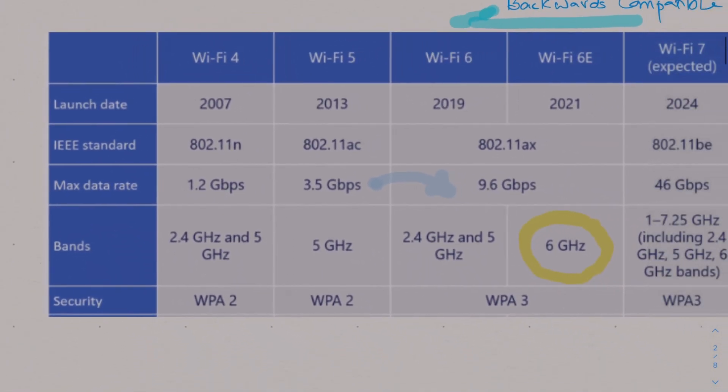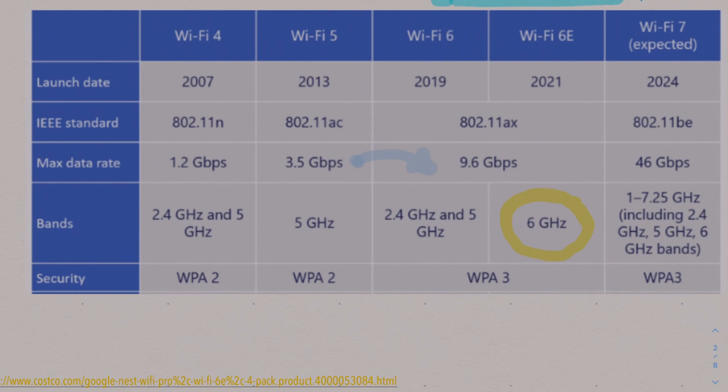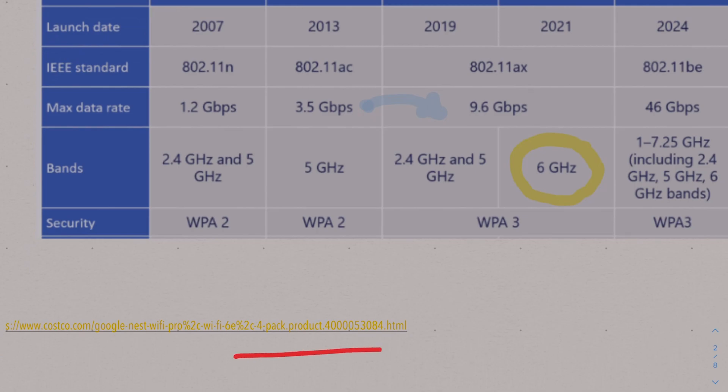Let's understand what we're getting in Wi-Fi 6. Remember, every standard is backward compatible. We are in Wi-Fi 6E — the latest and greatest standard. I'm jumping from Wi-Fi 5 to Wi-Fi 6, getting almost a three times jump in speeds within my router and devices. The main thing in Wi-Fi 6E is the six gigahertz spectrum, which is a brand new spectrum added by the FCC. That will allow you to go much wider lanes on your traffic, giving you very high speed — almost doubled compared to Wi-Fi 6, and almost tripled compared to Wi-Fi 5.